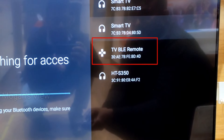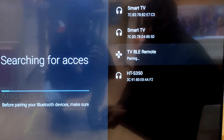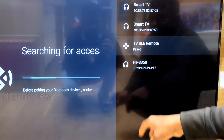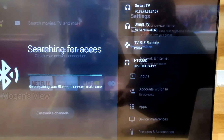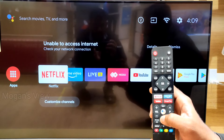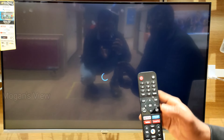See, right now this Bluetooth remote ID is visible. Press the navigation Down button and select 'TV BLE Remote,' then press OK. Now your TV remote control will communicate with your TV and it will show 'Paired.' After that, you can press the Google Voice key or YouTube key.